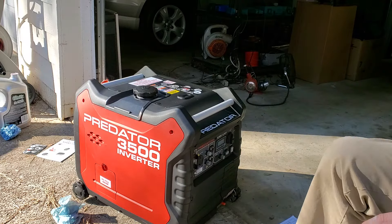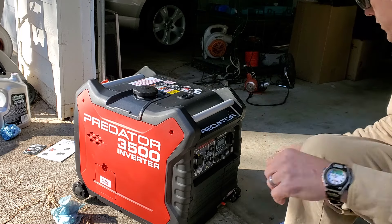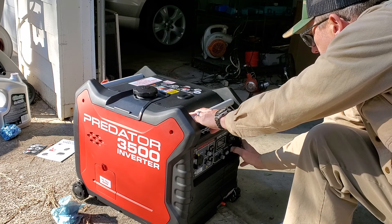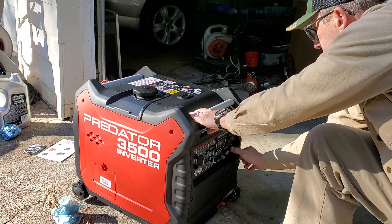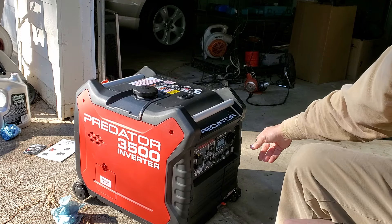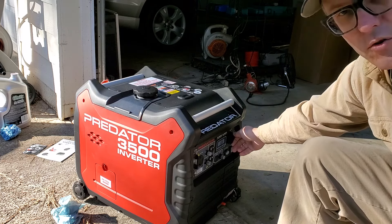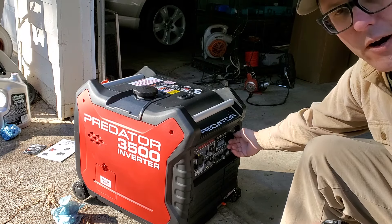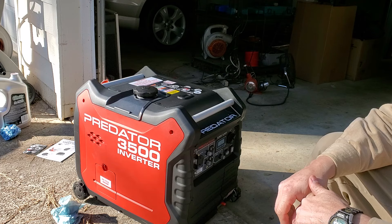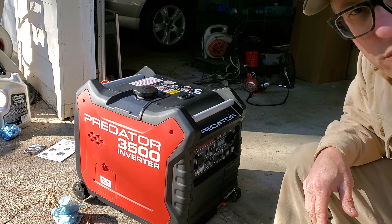Alright, check out other videos on our channel. Let's fire it up one last time. Since it's already been run, you don't have to put it all the way to start — that's the choke mechanism. If it's already warmed up, just put it to the run setting. The start position all the way over is basically the choke, and that's not necessary if the engine's already warmed up. There you go — sweet! Alright, that's it. Y'all have a great afternoon, Biker Dave signing off. Make sure you Google Horsepower House and look at our channel for all kinds of cool stuff. Y'all have a great day.